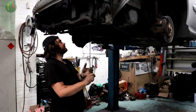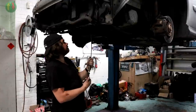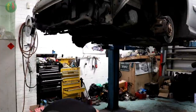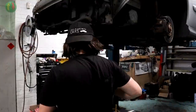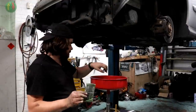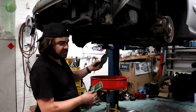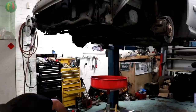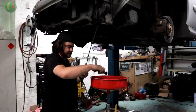So this is the bottom intercooler hose. If we thought the top one might be full of oil, this one is almost certainly going to be full of oil. I think I need to get my oil catch can. In the oil catch can I have an existing Citroën CX LHM filter which is broken, and the moon disc that goes in the bottom of the reservoir, which is just knackered — so that's going to go in the bin.